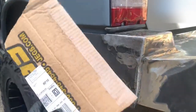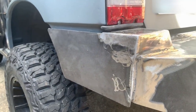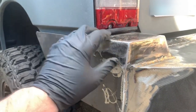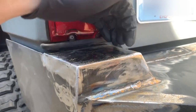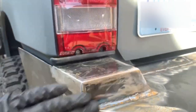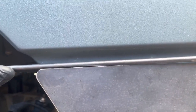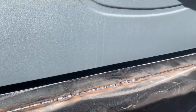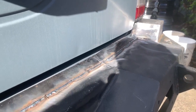I built up my pieces and tied that in underneath the tail lights. For this, I just cut out a piece of cardboard, make my template, and tack that in. For the other stuff I pretty much freehand it — figure out a piece, use the angle grinder to cut it, then start molding it around until it looks decent. I was thinking to tack this on and build a structural skeleton behind there with X's. These are just booger welds until I figure out what I want — I didn't want to warp it too bad. Then I'll come back, hit the backside, and grind it all flush.